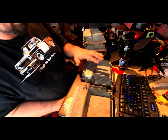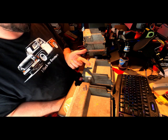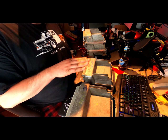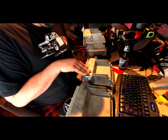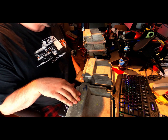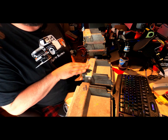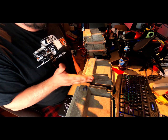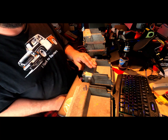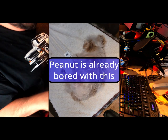Because I have the newer harness, I'm going to use the newer PCM — instead of going back and pulling that one out of the junkyard, I'll just use the newer PCM. These are 1 megabyte processors in the P59s, and 512 kilobyte processors in the 411s or P01s — there's twice the processing power in the P59. It probably doesn't matter to you. You can run boost, you can do all the cool things. But you can do a few things that are cooler on the P59.